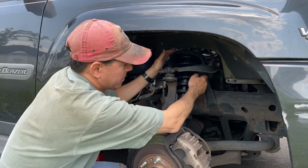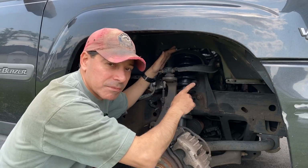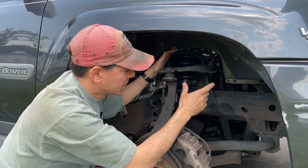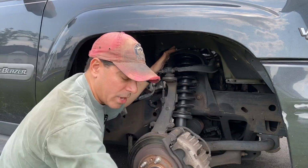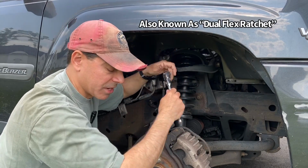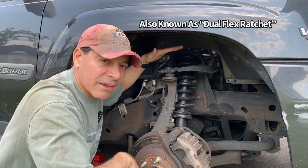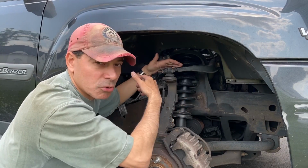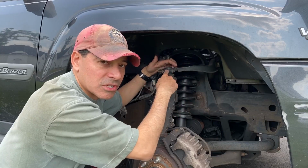Cylinder 2 is tucked right behind this strut right here. But I'm going to get a close-up and show you there's a little access area that GM has given you where you can access that with an articulating ratchet that we can feed up in there with an extension. But we are going to have to remove the upper control arm and the strut from the upper strut mount just to pull them out of the way to access it. But here's a close-up of it.